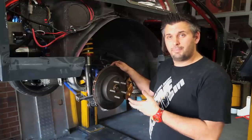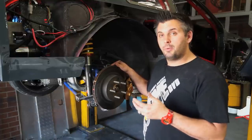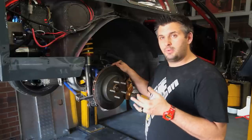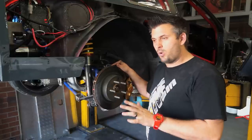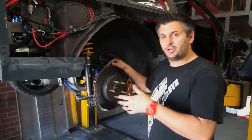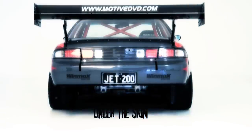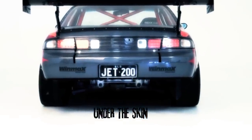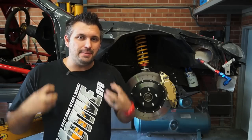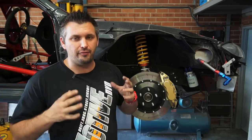As you can see, we've got a lot to develop in the rear end and we'll be playing around with that once we hit the track. But with these changes, we're confident we can get more traction at the back with better squat, and the camber curve is going to be reduced, so we're going to have better corner exit traction as well.